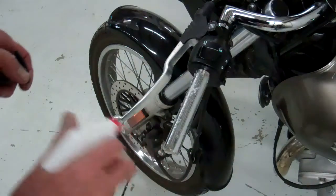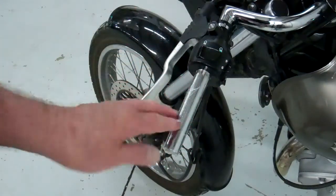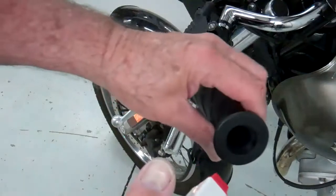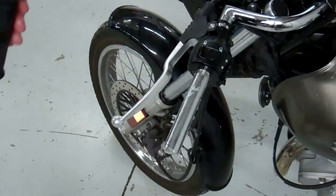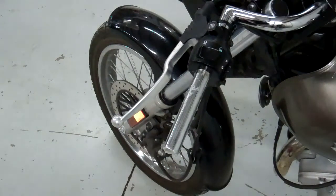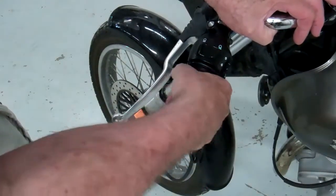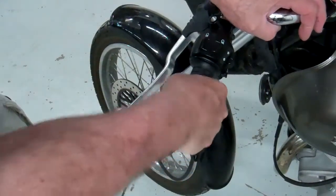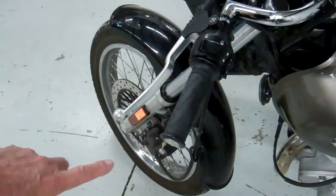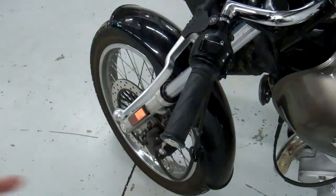Go ahead and spray the tape — make sure you get real good coverage because you don't want any bare spots. You can rub your fingers around on it a little bit too. Then go ahead and wet the inside of the grip and we should be able to just slide it on there. I've slid it on. There's just a little bit of the handlebar showing here. We'll wait until tomorrow or the next day and then we'll trim that off before we put our bar-end mirror in. And there you have it.